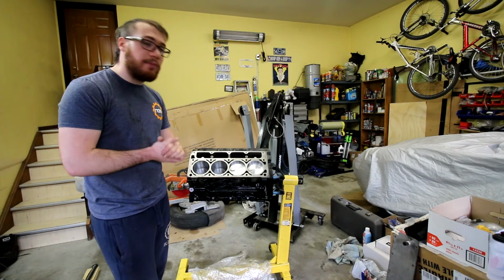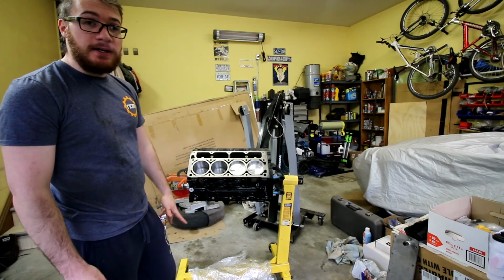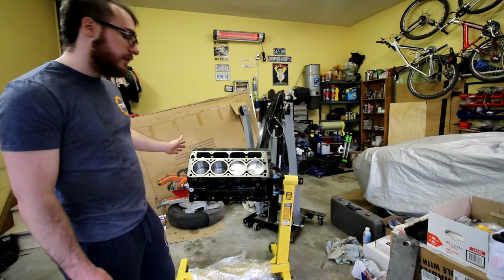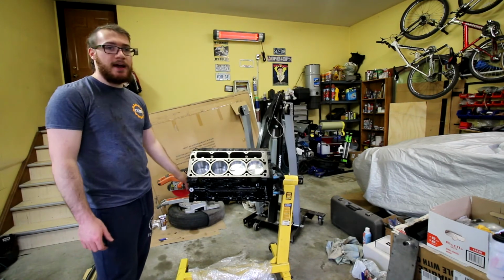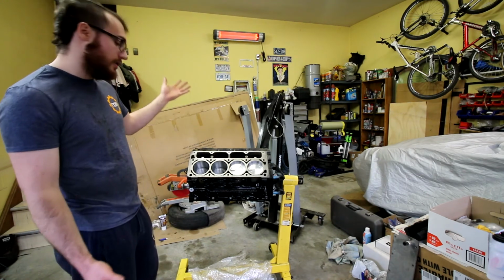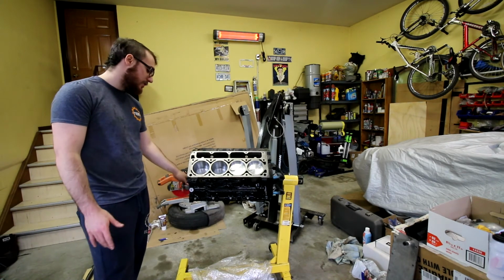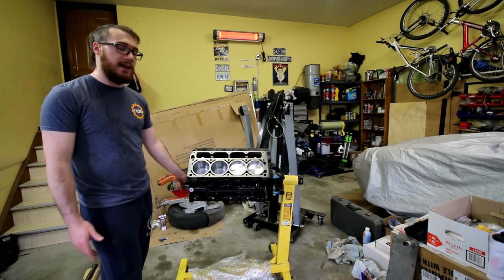After quite a long battle, I can say that, yeah, I've been defeated. First hurdle has definitely put a roadblock in moving forward on the front side of the engine. The front crankshaft timing gear set needs to be pressed on, and I assumed I would have something in the shop or in the garage here to make that work. Of course, I've been troubleshooting for so long, haven't been able to figure something out on the front here, so I don't want to damage anything. I don't want to brute force and smash this in.